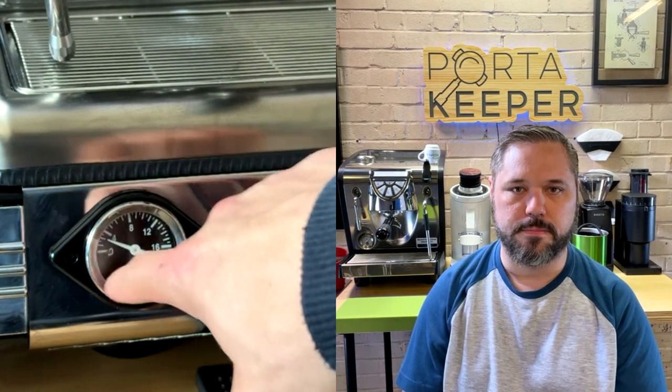There's a pressure gauge showing steam pressure and another showing brew bar pressure. La Spaziale actually recommends the brew pressure sits between 1 and 4 bar at rest — it's lower than you'd expect, because when you pull a shot it ramps up. This gives a soft pre-infusion, so water isn't jetting into the puck too fast, resulting in a more even extraction every time.